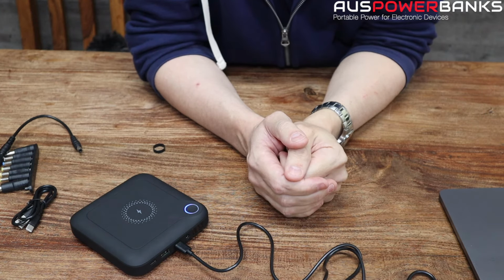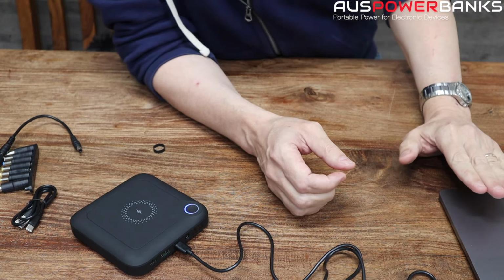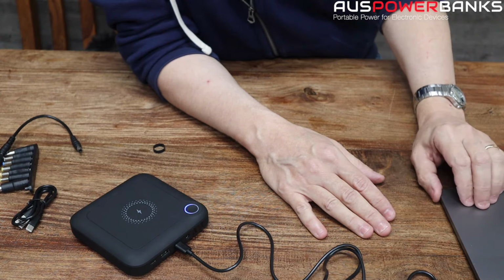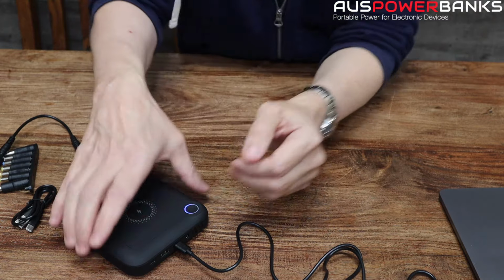You'll find most will. Even this MacBook Pro, for example, the supplier gives you a 95 watt wall charger with this. This charges fine at 60 as well though. Some laptops won't. Especially big gaming laptops and stuff like that, they probably won't charge at the 60 watts, so that's just something to keep in mind.